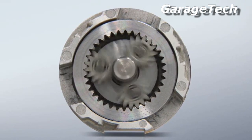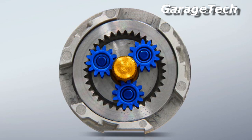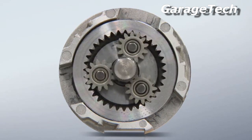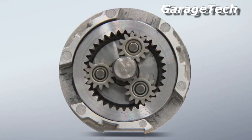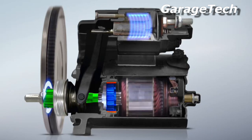This type of gear set consists of several gear wheels. The sun gear is at the centre and is driven by the starter motor shaft. The planet gears in the middle circulate on the teeth of the fixed ring gear on the outside. They transfer the force to the shaft of the mounted starter pinion. This is how the planetary gear set converts the high motor speed to a low speed with more torque. The pinion is therefore subject to higher forces — that's how even a small starter motor can start an engine without any problems.